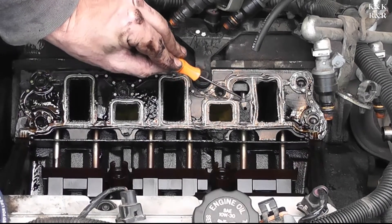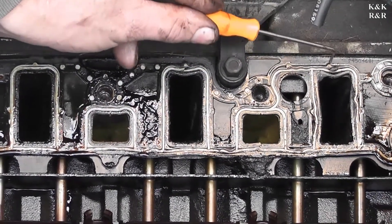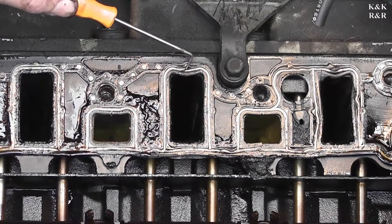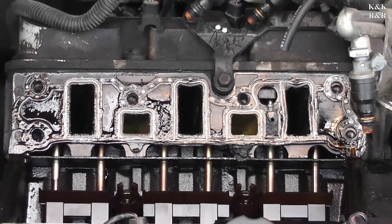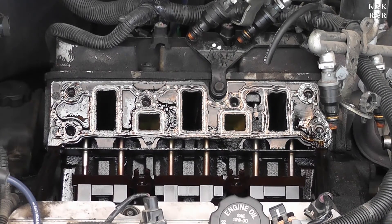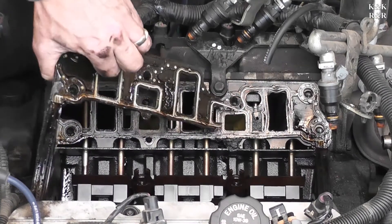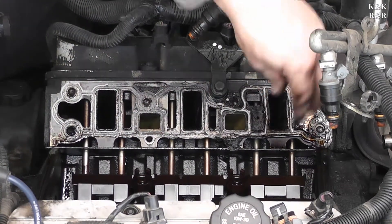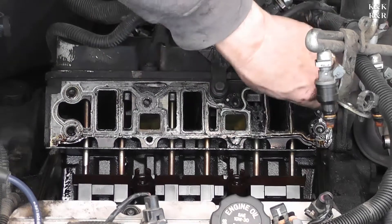As you see right here, it was actually bowing out because the oil-soup mix got in here. It's broken here — that's a water port. Right here where it's all white, that should be straight but it's not. It's broken. So we definitely had some intake leakage anyway. I knew it was bad; I just didn't know how bad. But I think this is going to be the worst of it, because we're going to be able to clean it up. We know the motor runs, we know it didn't tick, it doesn't have any damage from being hydrolocked — thank God, because finding these motors is not easy. We're ready to remove the lower intake gaskets. See how it just breaks apart? You're going to have to shop-vac the heck out of this motor, for sure. It should not be two pieces.